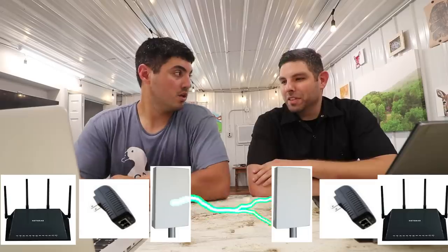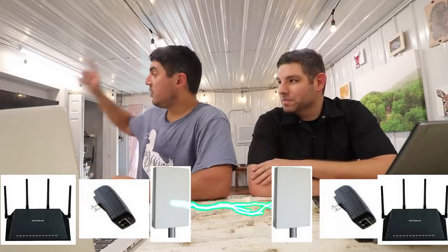And what was the device that you have there that we're using? This here is an Apple AirPort. Have that set to bridge mode, so that way we don't have multiple DHCP devices handing out addresses. So make sure to do that.